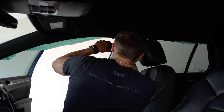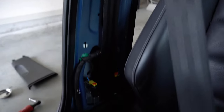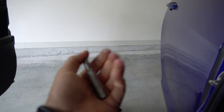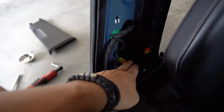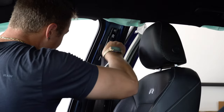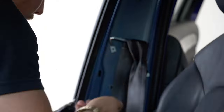With that screw out I can take the first piece of trim off. The next piece is easy since it's only held on by plastic clips. With the seatbelt covers out of the way, I have room to access the last two bolts to remove the seatbelt — one bolt here and one bolt all the way down at the bottom, which might be tough to access. What's really unique about this car being a Volkswagen is the type of bolt it uses — a special M10 spline bit, found mainly on European cars. Then the last step is to unplug the two yellow clips — yellow usually means explosive, and believe it or not, this is an explosive belt. Using the special 10-millimeter spline bit, I was able to remove the first part of the seatbelt. Next was removing the bracket with the torque spline bit that holds the seatbelt to the pillar.